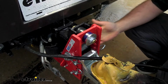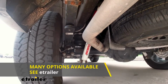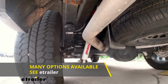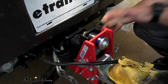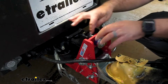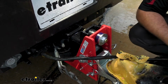The airbags, I've installed plenty of airbags on trucks, and it's great for having that heavy load, and they do an awesome job of supporting it and really taking some of that out. But that's doing the heavy lifting. You still have this nice cushion here, so it's also going to reduce it. So you get a battle of both of these working together against that chucking. While this is supporting the weight, this is going to soften that sharp impact blow. So with both of them in conjunction, you're going to get a nice smooth ride.